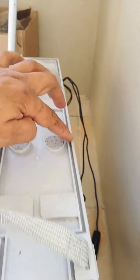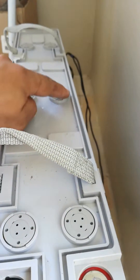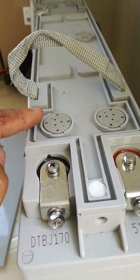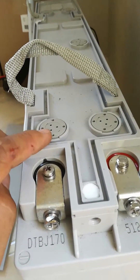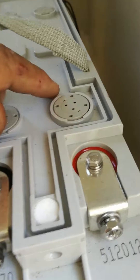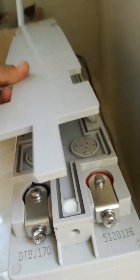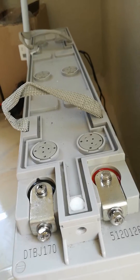This is the channel going all the way through the back here. These vents of the cells — once you're charging, it bubbles up and escapes here. The escaping gas flows through this channel, going up to that port and escaping through this hole. Once there's a spark near enough to this area, as you can see, this is full of explosive gas right there.